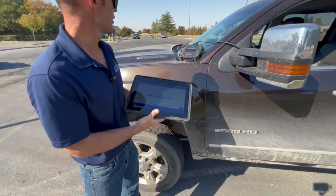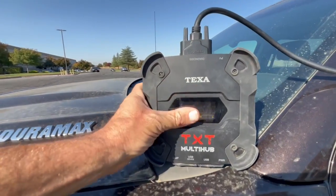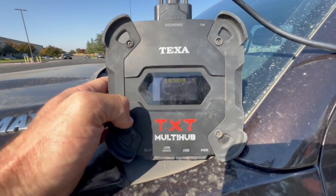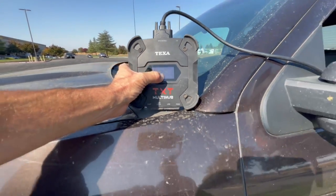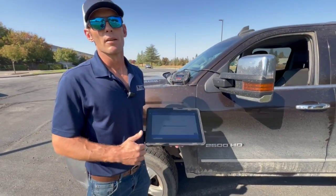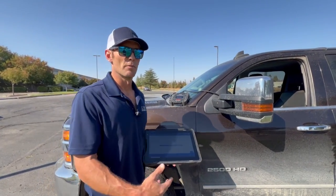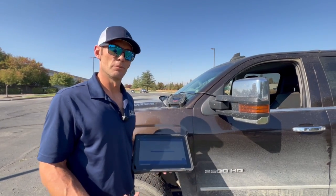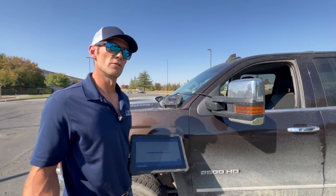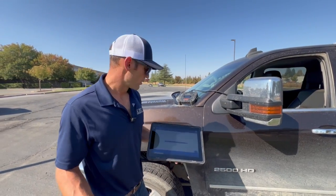Right now our device is initializing, communicating with our Navigator TXT Multi-Hub, and then it's going to begin the scan. This is just released from TEXA — it shows your voltage and your mode of connectivity. One nice feature is the maximum/minimum value. With newer vehicles, voltage is king. With all of these new systems, modules, and multiplexing, diagnosing gremlins often comes down to your batteries. Being able to efficiently load test it by having this connected and starting the vehicle, you're able to see if your batteries are holding up like they should be.